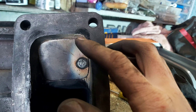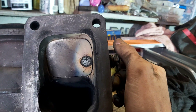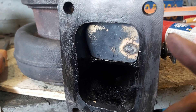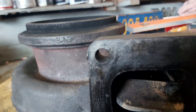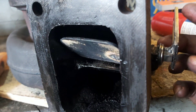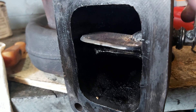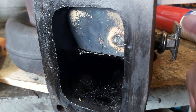The other one had an issue — too much pressure trying to go past it, and the wastegate wasn't quite strong enough to open it. For this one, I used a hardened bolt with a really smooth sleeve — no threads on it. I found a drill bit that was two thousandths of an inch bigger and drilled the hole through the housing and through two nuts. There's no free play at all — it's really tight but still smooth and didn't leak.